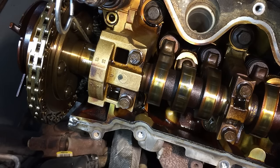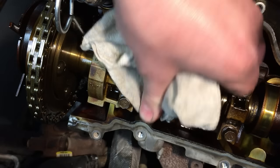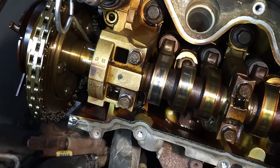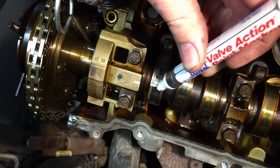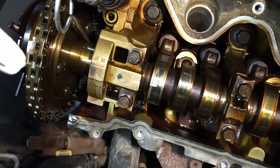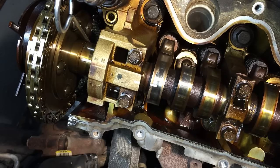The other thing I do is bust out the brake clean and clean off the cam cap and the first lobe. Then we make a paint mark across the two — the cam and the cap — so you can see exactly where they should go back together. If the cam pops over to the left or right it happens so fast you'll never see it. You'd be guessing among all those cam lobes. This way we know what direction it popped once we're working the phaser around.